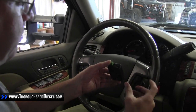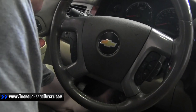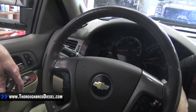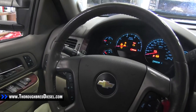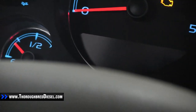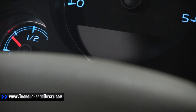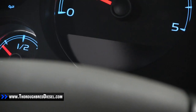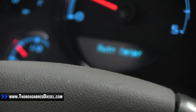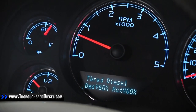Now we're going to disconnect the dash control and install it in the truck. I'll switch over to profile number one right here, then go ahead and hook it into the OBD2 port. It'll flash the power light for you and come up in the DIC. I'm just going to unplug it and reinstall it — unplug from the OBD2 and plug it back in. Autometer dash control will come up in the DIC, version 2.1.